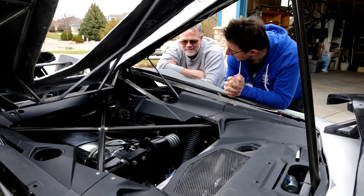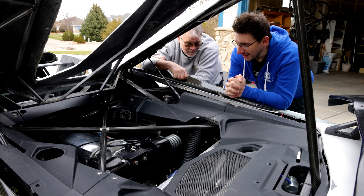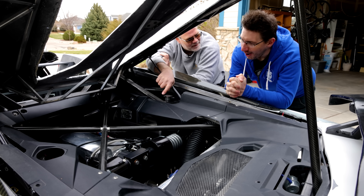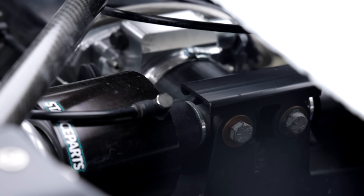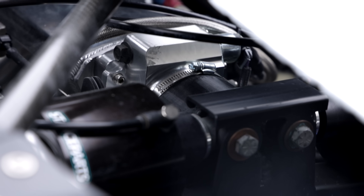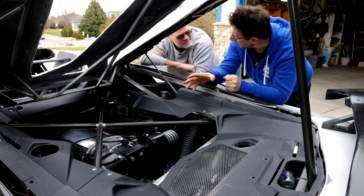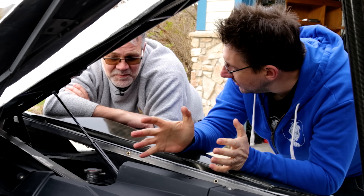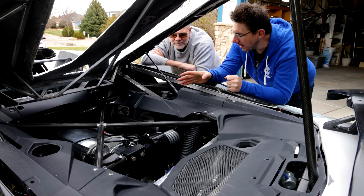You asked about 3D prints in the engine — you see the intake cup there? That's 3D printed. It's actually printed out of nylon carbon fiber. It's cool to see a 3D print in the engine. It makes a lot of sense — that's not a part that's going to get hot; it won't reach the glass transition temperature.